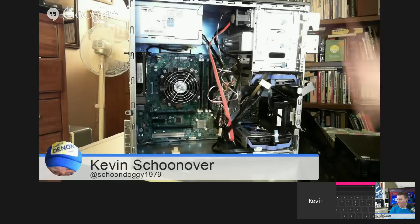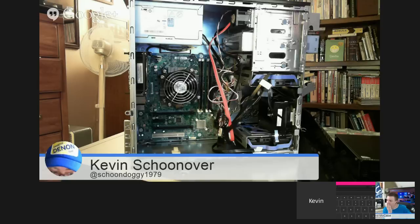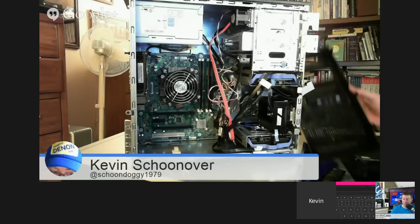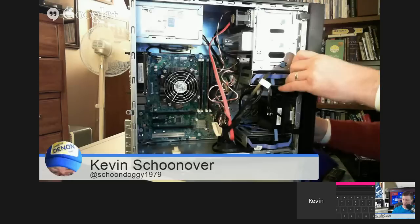and have a pretty well-rounded little server. Yeah, I mean that's a perfect little RAID 5 set with a mirrored OS on SSD. That's a great entry-level server. You could do Server 2011 Essentials, yep. Server 2012, you could do some virtual machines, especially if you're running a Xeon, put 16 gig in there. Yep. So run me around the motherboard, okay?